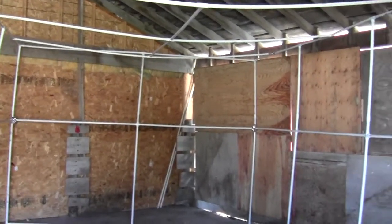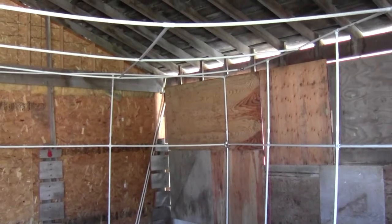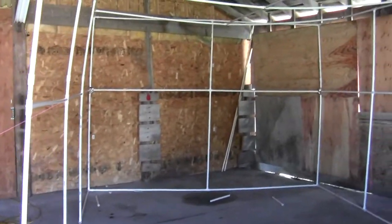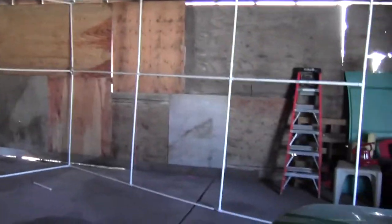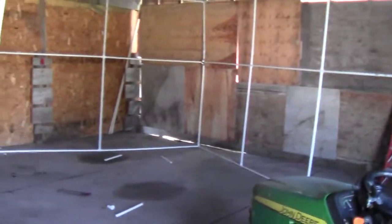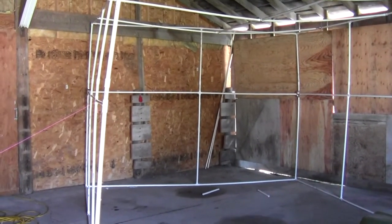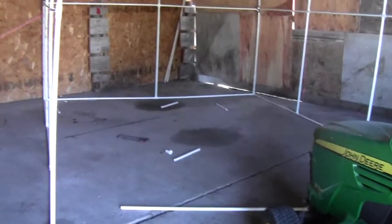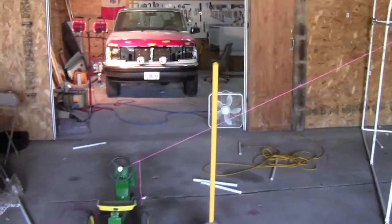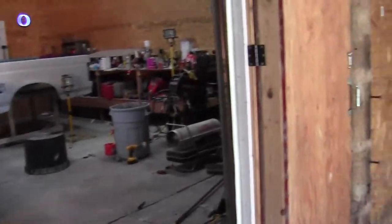The idea is to put two fans up high on one end, and the other end will be the exhaust. I may just leave that end open. The weather this weekend couldn't be better — supposed to be 70 to 80 degrees. Sunday is paint day: low humidity, hardly any wind, and it's from the southeast. I could probably paint in here without anything and be okay. I'm going to wet the floor down before I paint — I understand you get 80 to 90% of debris in your paint from the floor, kicked up by your feet and air hose.